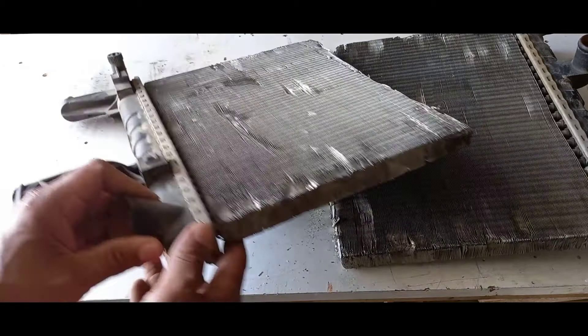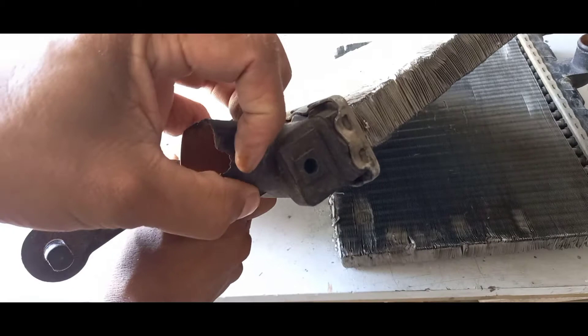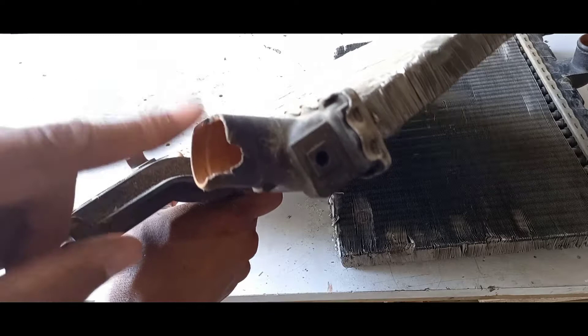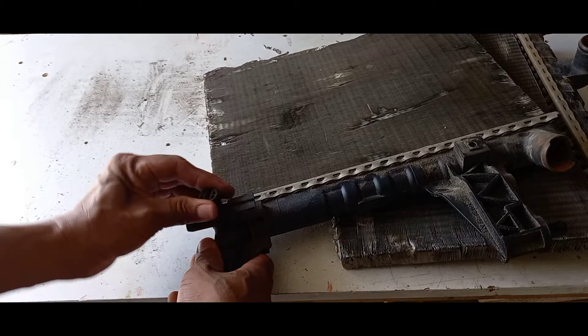If you look closely, you'll see there's a break in one of those pipes. Water can be leaking out without you knowing it — there's a clamp that goes around this, and pressure may be seeping out, which will depressurize your cooling system. At the bottom there's a drain plug for when you flush the engine — it's a simple device that turns open. Inspect it, make sure it's closed and tight, and check there's no leak from the drain plug.